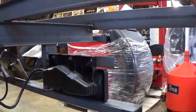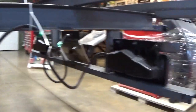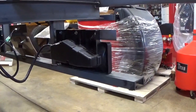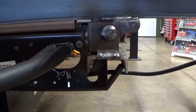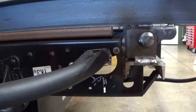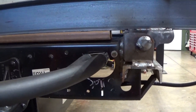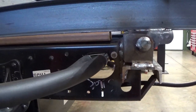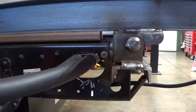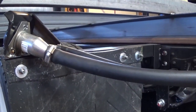From the center of the pin to the end of the bed is about four feet, and when it's all the way down it's about a foot off the ground — that's why the tail lights are moved in and hanging where they are. The important thing is measuring out where that hinge is. In between the main rail of the bed and the frame of the truck we've got treated lumber — this one happened to be the plastic composite material that lasts forever. We welded the mud flaps and the gas fill right off the side.